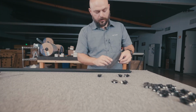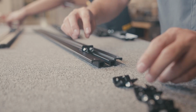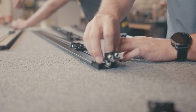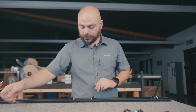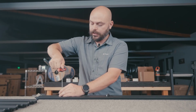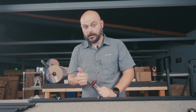So all you have to do is really just grab that M6 nut and kind of slide it in. And again, just making sure you're paying attention to the orientation that you're doing. That right there. So now at this point, this rail is pretty much done. However, in order to get these out of the way, unless you have a giant production area behind you, a really good idea is just to go ahead and slide these down the channel and only on the outer 2 on the ends. Just get it started nice and tight so that way it's not gonna actually slide out.